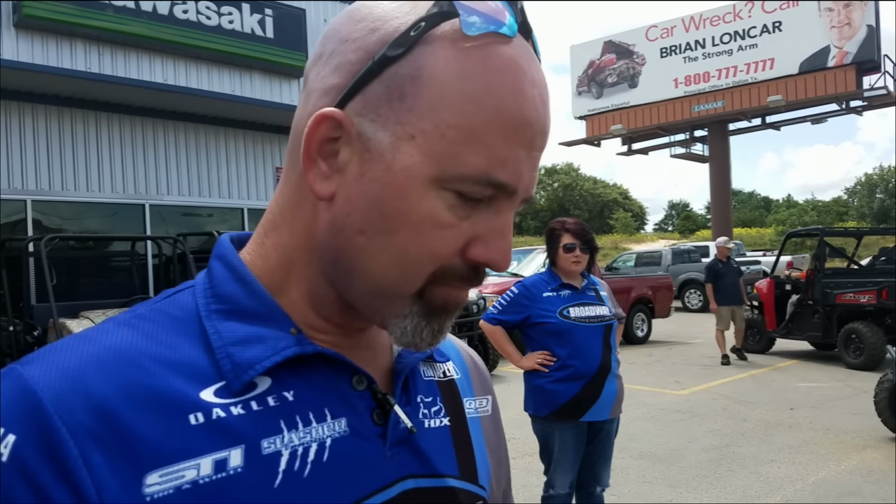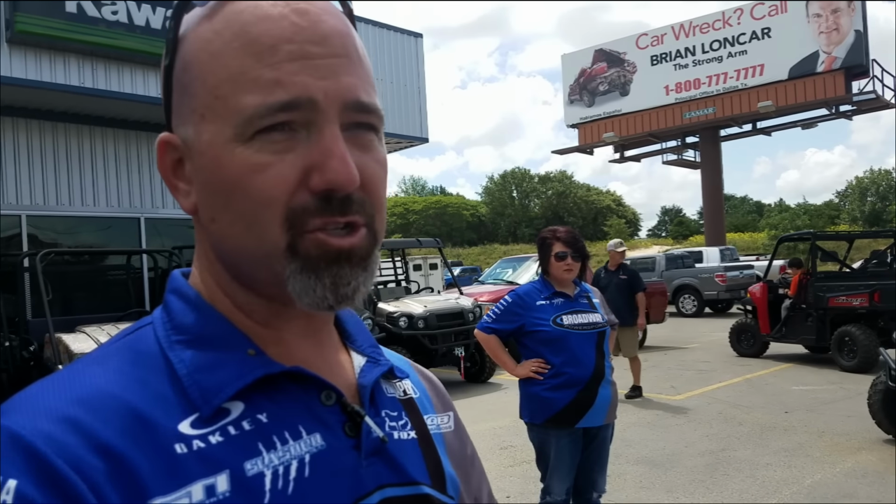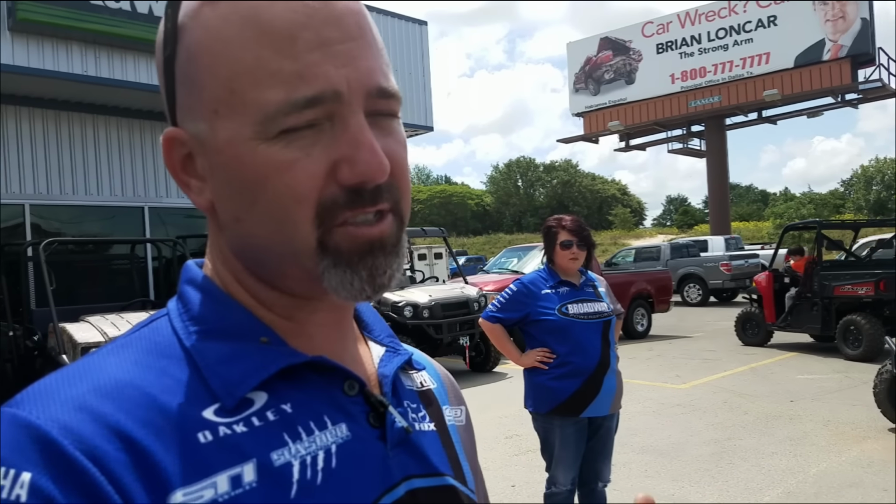What about ethanol? Ethanol free is the best, but if you can't find that, which most people can't, as long as you're keeping fresh gas in there, you're okay. If you're going to let it sit longer than 60 to 90 days, I would recommend a fuel stabilizer. Like I said, during the winter, just drain it all out if you can. That's the best way to make sure you don't have any issues.